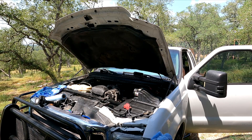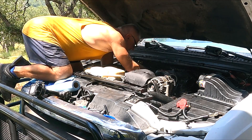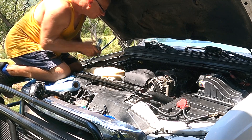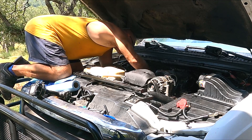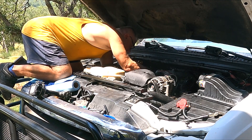It fires up fairly quickly after that, but the bad part was it's only firing on the driver's side — sounding like total gobbledygook. I was hoping it would clear up but it's not. I knew what had happened — about two years ago the injector harness on the passenger side died on me. I put my hand on the manifold to see if it was warm and it's totally cold, not firing at all. So I ordered a new harness from Amazon and waited to get it.